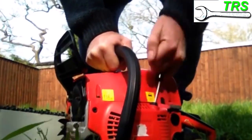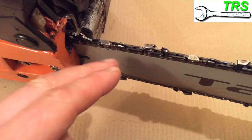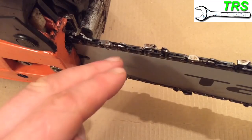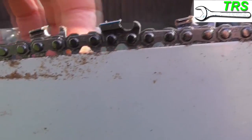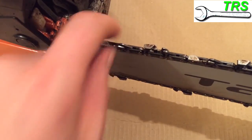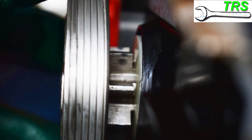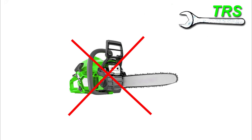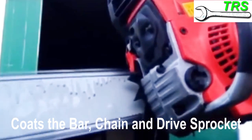Stale fuel is undoubtedly one of the top causes of an engine not running or starting after a long period of storage. The next thing I would tend to is the chain. I would want to make sure that before I stored the chainsaw there were minimal water droplets on the chain and that it was well lubricated. Something I really wouldn't want after a few months of storage is to pick up the chainsaw and find the chain is really rusty. If the chain's rusty, the chances are the area of the bar that contacts it is also rusty, and so is the drive sprocket. To prevent this, I run the chainsaw with plenty of bar oil in it so that it coats the chain well before it goes in for storage.